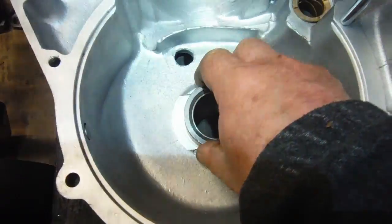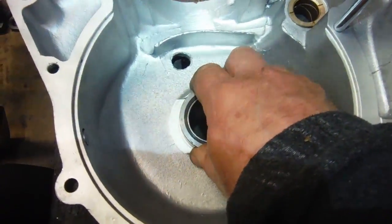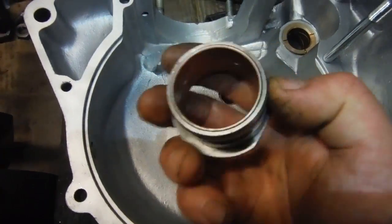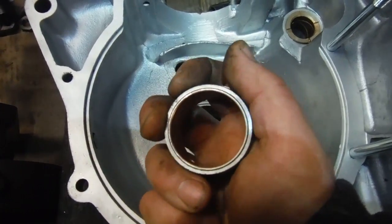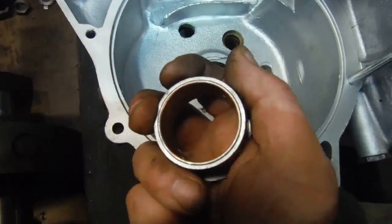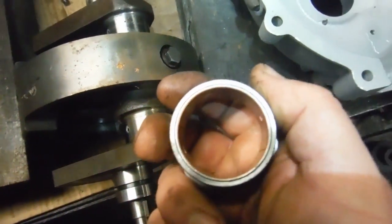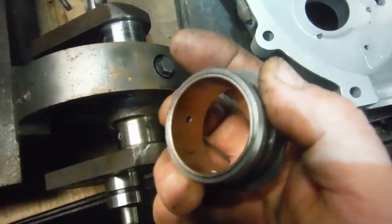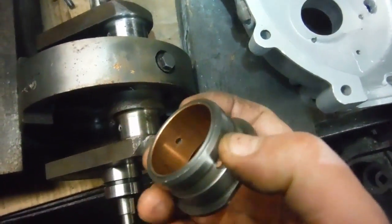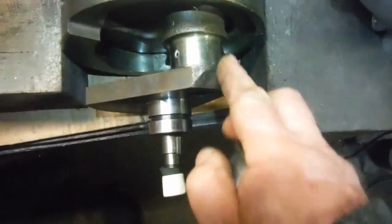I'm going to warm the crankcase up and will probably still have to press or drive it in to some degree. When it's fitted and cool, it'll have contracted into a very slightly smaller diameter than what it is now. So it's very important to have that fitted, know that it's true, and get the measurements — which is what John will be doing at his regrind and rebore shop.